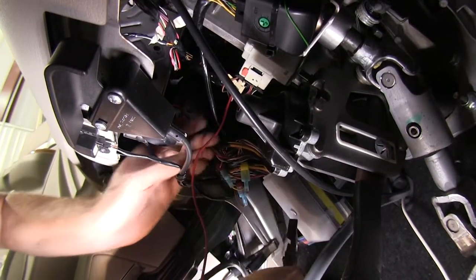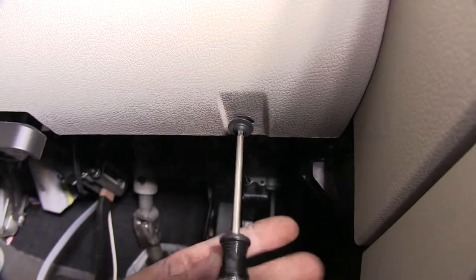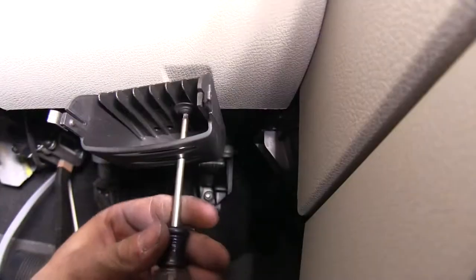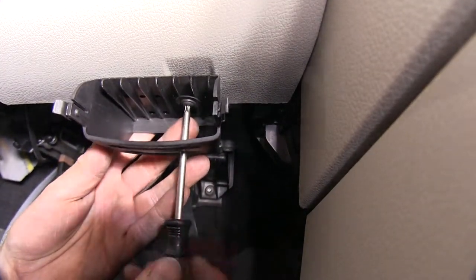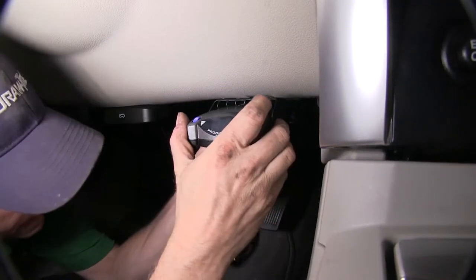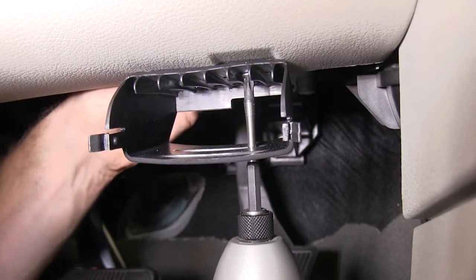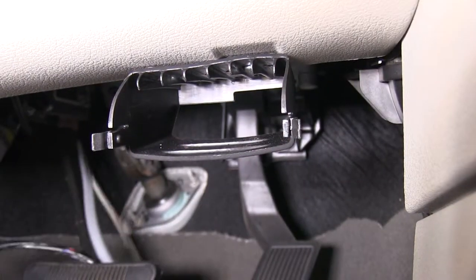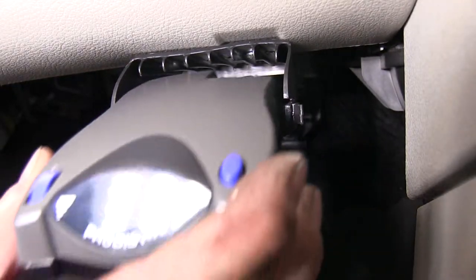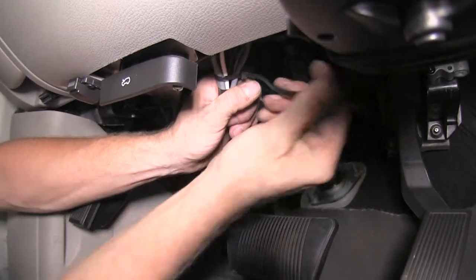You will need patience with this because it's a very tight fit up there. With connections made underneath the dash, we'll go ahead and install our pocket for the brake controller. We'll use one of the factory screws on the bottom to hold the pocket in place — remove the screw, put it in the pocket, and reinstall it. Then install another screw next to it using one of the provided screws going right into the plastic. When we tested fitting the brake controller into the pocket, we noticed the factory screw was too large and took up space, so we found another appropriate screw with the same threads. We'll take our wire harness, run it through the back side of the pocket, and plug it into the back of the brake controller. Then slip the brake controller into the pocket, and take a moment to tape up and zip tie our wires safe and out of the way from the pedals.